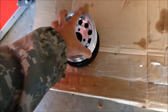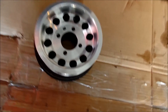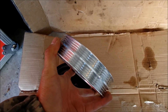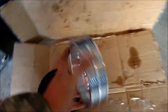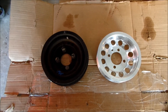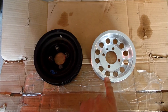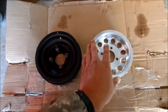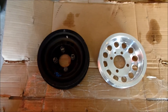It's actually an underdrive pulley. You can tell lining it up - the old one is slightly bigger. What that means is your alternator, air conditioner, and power steering are not going to be as powerful anymore. But your engine will not be working as hard to drive those components, which is why they call this an underdrive pulley - it underdrives your accessory belts. It's lighter and spins everything slower so the engine doesn't have to work as hard, so you get more horsepower.